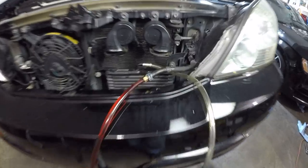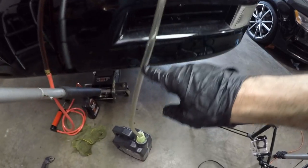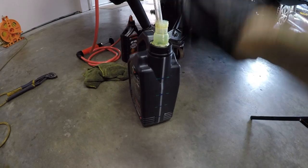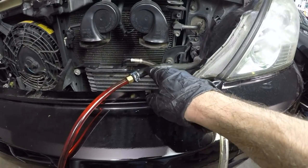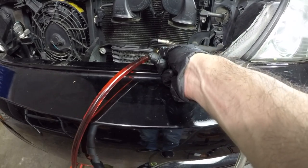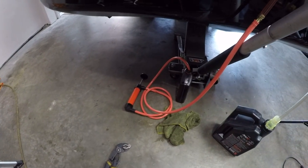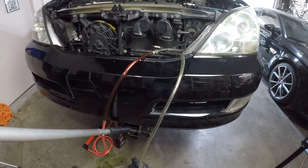This is a very makeshift system. I pulled that hose off of the oil cooler and attached an external hose that runs down into a graduated bucket — an old oil container marked for quarts. That's where it's going to be draining when you turn the car on. I'll drain about two quarts out and then refill two new quarts through the detached hose using some airline fittings from a hardware store, some clear tubing, a transfer pump, and a new quart of transmission fluid. It's somewhat imprecise, but you can make it work with stuff you have laying around.